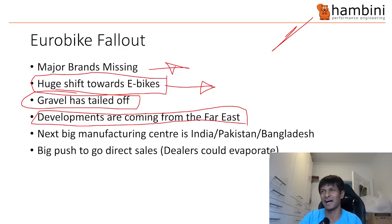But in idle conversations with people that I had, I'm thinking even the tubeless and the sealant is not a great idea for road use, because people are now complaining of out of balance. I've been saying that for a while, but it's a lot worse when you've got sealant, because you can't get rid of the moisture in the air that you put in, so it will slightly go off. And if you do get a hole in it, it seals itself, but it doesn't send the sealant around uniformly. If you leave your bike in the shed or the garage for a while, go back to it, you might find the sealant has coagulated around the bottom. When you're riding along, especially on the front wheel, you can feel the handlebars shimmying slightly.